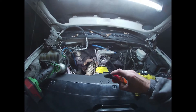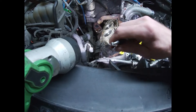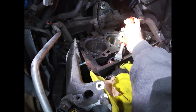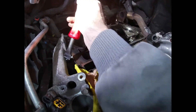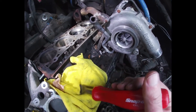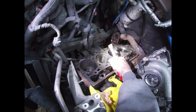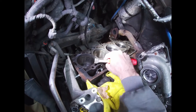The only special tool I recommend having is a carbide blunt scraper — you can order these online. It's flat on the end but a very hard material. On this surface here that's rusty and oily, you can see it just peels it off — takes rust off, takes gasket material off. I don't recommend using any power tools because no matter how even and straight you go, when you get to one of these edges you're gonna round it off. The most important part of the head is gonna be rounded off right in here.